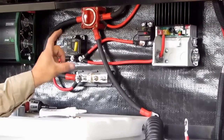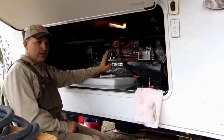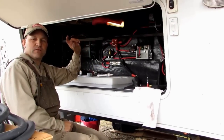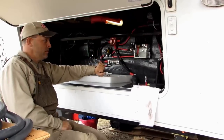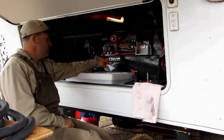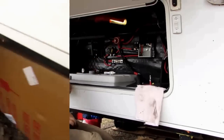That's fluid film. Fluid film — it lubricates, but it's also good for battery terminals. It's made out of lanolin and it keeps away any corrosion — it's a corrosion inhibitor. So that's a good thing to have. This antioxidant compound helps with conductivity and corrosion, but the fluid film is a corrosion inhibitor. We'll go around putting it on all these little connections.